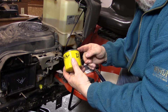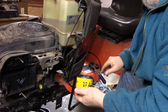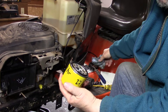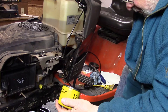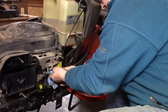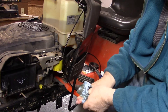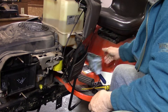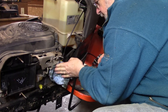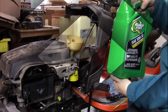You get a little oil from your container and put it on the oil ring. What some people do — and I think it's probably not a bad idea — is because this oil filter is mounted up away from the sump, they'll fill the filter with oil first before installing it. So that's what I'm going to do: put a little oil in it and then install it. By filling the oil filter beforehand, you eliminate the chance of no oil being pumped as it fills up the filter canister. We just snug that up — it doesn't have to be singing tight, it's just an oil filter after all.